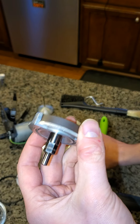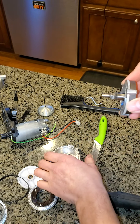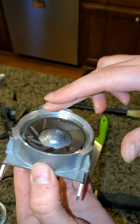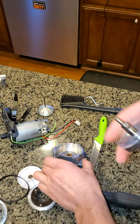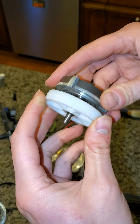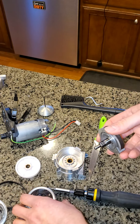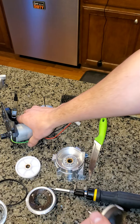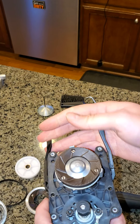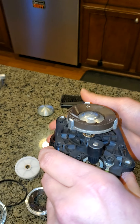There are three parts to this. There's the thicker cylindrical section, which fits through the bearing in the grind chamber and spins. There's the hexagonal part, which the gear goes onto, and that attaches to the belt to get motor power through. And then there's the lower part, which goes into the motor plate bearing. This rests on the wedge, and the wedge moves this up and down — that's how you make adjustments.